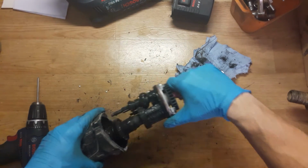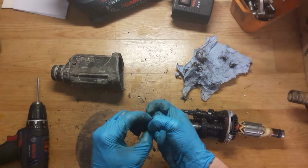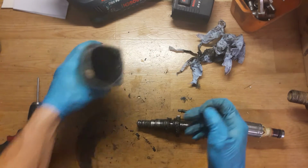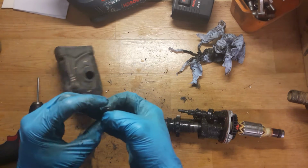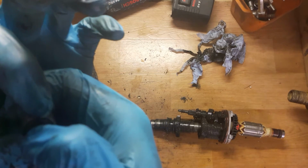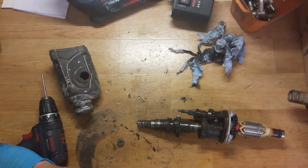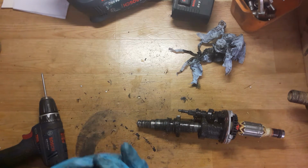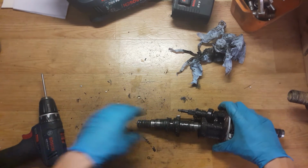Ouch, the camera holder. Okay, what we have here? It's a ball bearing. This ball bearing was in a gear housing, like in there. It's almost broken, so as you can see it's all moving to the side. So we need a new bearing, of course. Then we need to check all housing. Okay, it looks good for me.